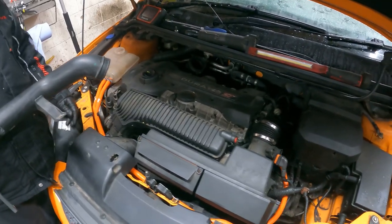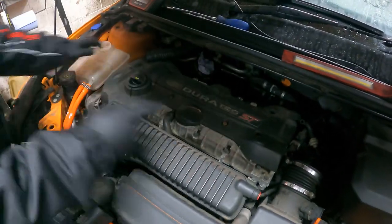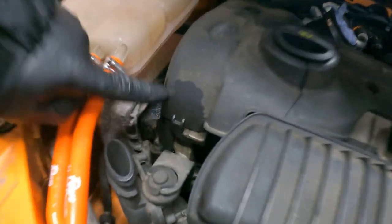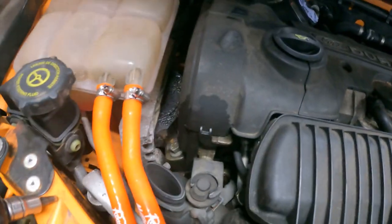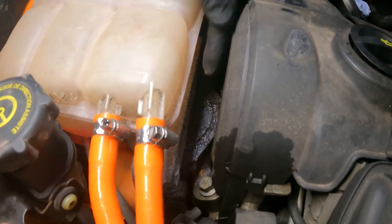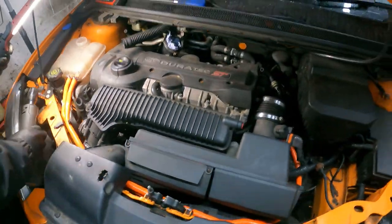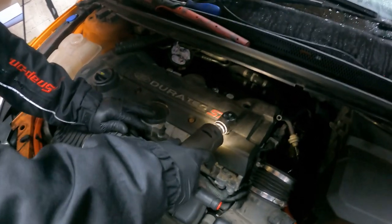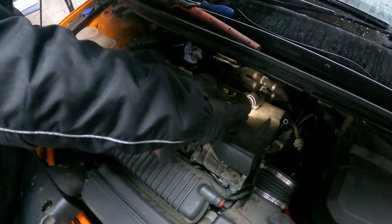Yeah, so it needs an engine rebuild anyway. So we're going to get all these covers off now. Also notice, while we've just been talking, it looks like it's got a cam leak — there's a lot of oil around here and it looks like the engine mount has actually leaked as well. It looks very crusty. We've bunged up the induction — you don't want any bolts dropping down there because that makes the turbo fail.